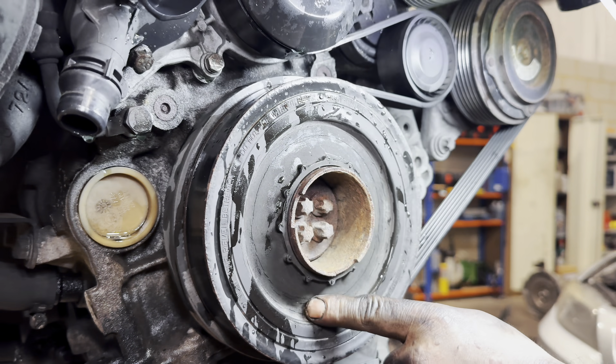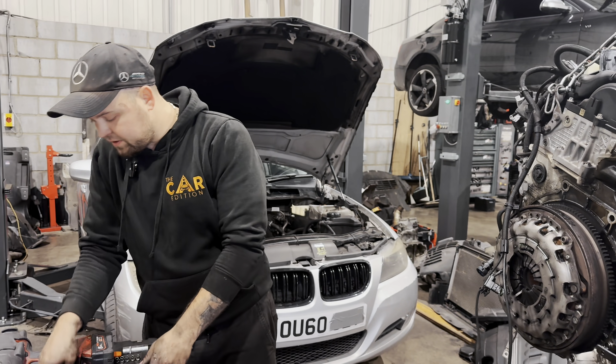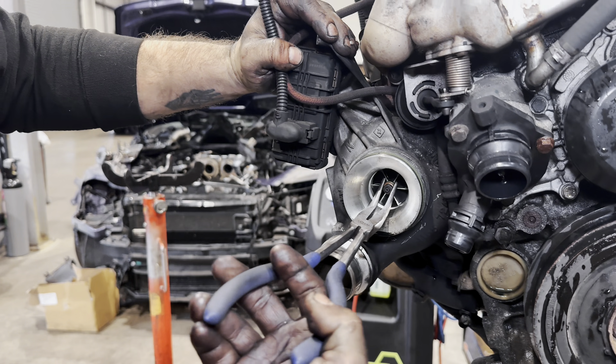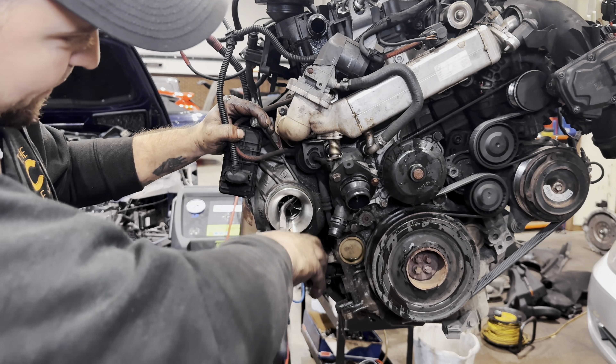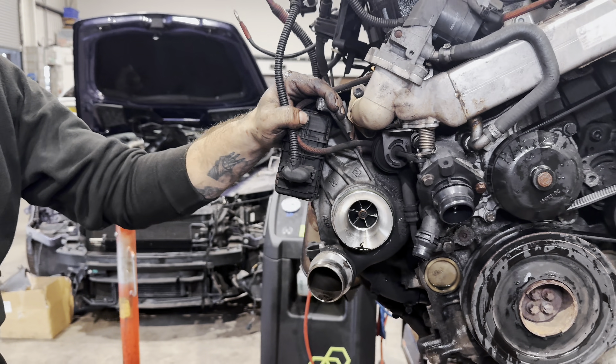Overheated. Pulley is cracked. From outside nothing else — let's see the turbo. Turbo bad. Standard problem as well — third N47 in a row, again turbo and chain.